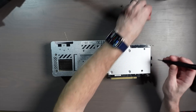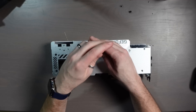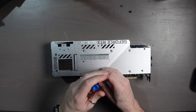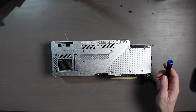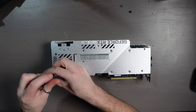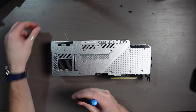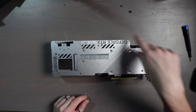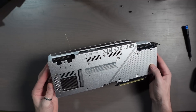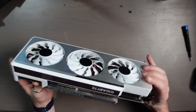So we're going to get going here. Taking out the screws on the back plate — got those four and then the two smaller ones. If you guys need any of the stuff I use in these videos to take apart GPUs, it's all linked down in the description below, all really cheap. This stuff's not hard, guys — don't be intimidated by any of this. Got those out, see two more over here, going to remove those. Don't give me a hard time for my screw organization. If you need to, draw an outline of the GPU on paper to place your screws, or use a magnetic screw mat. Got those out of the back plate — I think that's probably it holding in this cooler. Let's see if we can loosen it up.